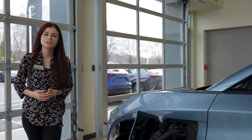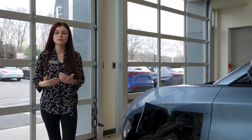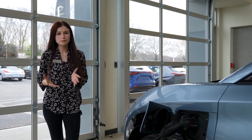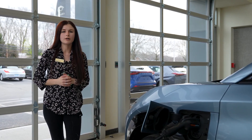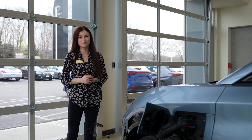When it comes to charging your RZ, there are about three different levels. An AC level one charger will take multiple days to fully charge your RZ. An AC level two, such as this one, takes about 12 hours to fully charge. And if you DC fast charge to about 80%, you'll get there in about an hour as well. Now with that, let's take a look at the interior of this RZ450E.